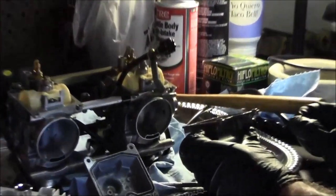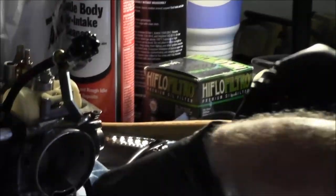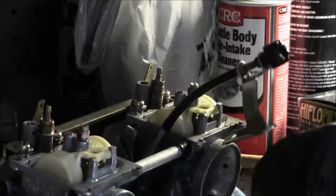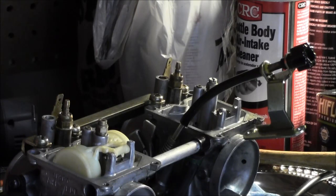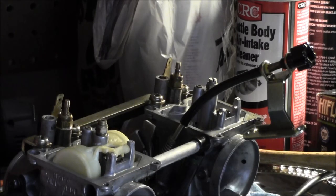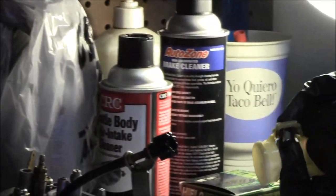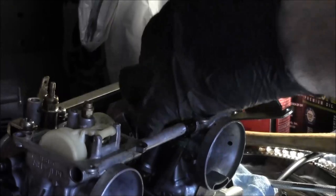Yeah, it looks like this gasket was leaking. Crusty. There's crust all around the perimeter here. Especially back here. I don't think your needles were necessarily an issue. Is that gasket? But I mean, they could also be, they feel pretty hard. So that's not good either. If they're too hard, it's not gonna create a positive seal.